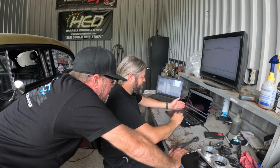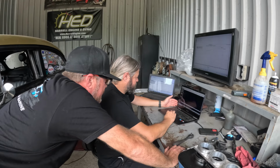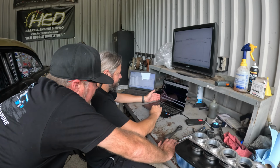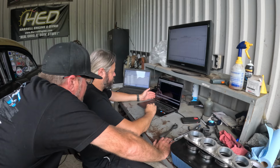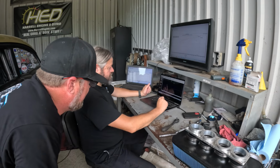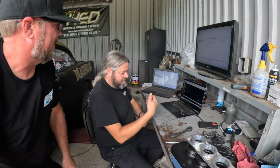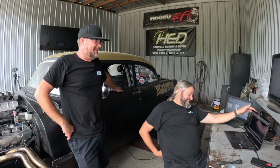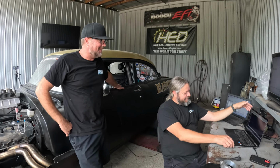What's the start of the run at? 240. So it is going down during the run. So the ethanol is working. All right. 220 is still a lot. God, if we could get it down to 130, imagine how much power it would make. What if we sprinkle a little straight M1 in there in the tank? Like, what happens then? Just a little something, you know?